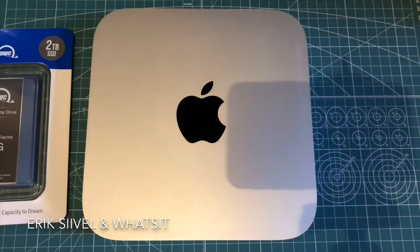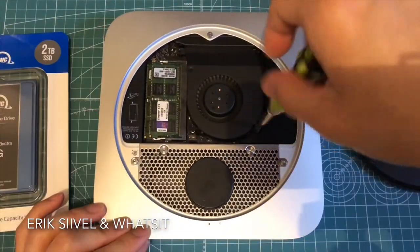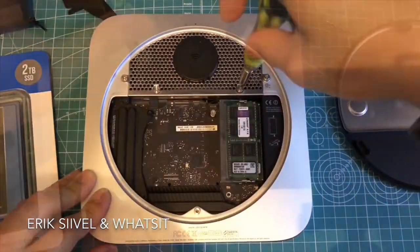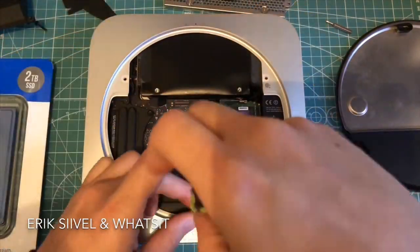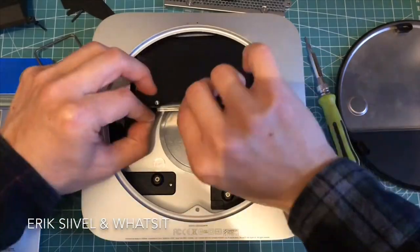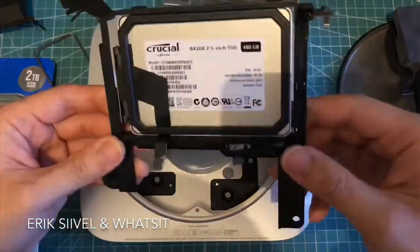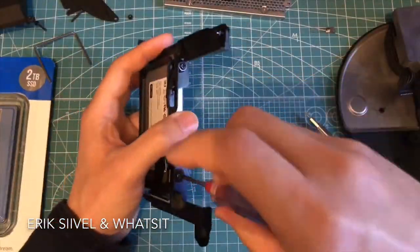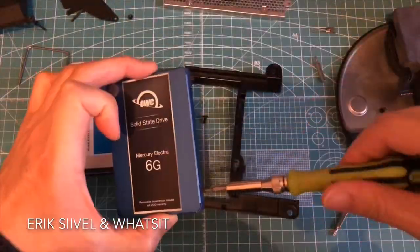Here's the methodology of comparing the speed between the Fusion drive and the dedicated SSD. I will fresh install the Mac OS High Sierra on the Mac Mini twice, one with the Fusion drive and one with the dedicated SSD. Then, I will restore the Time Machine backup into the drive, respectively. After that, I will compare the time required to start up and the time required to launch some major applications.